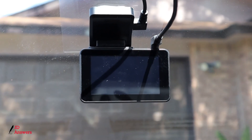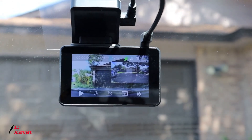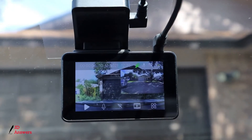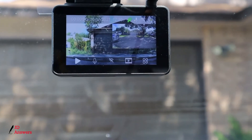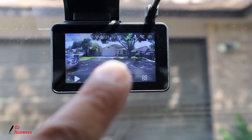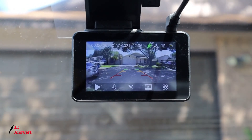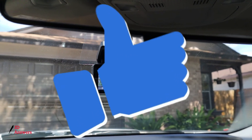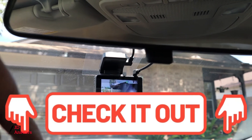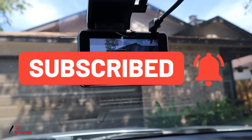We're back at the dash cam — going ahead and turning on the power source. We know power works because we installed the power cable. You can see the rear camera is working on this side. Now we need to see if the backup light work is functioning — putting the car in reverse, and you should see grid lines appear. There are the grid lines, which means the backup camera is working. We have the rear camera on and the backup camera working. If this video was helpful please give me a thumbs up, and check the description for product links. Don't forget to subscribe for all upcoming videos.